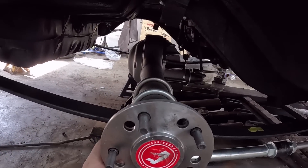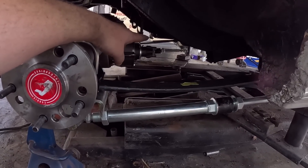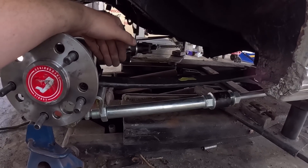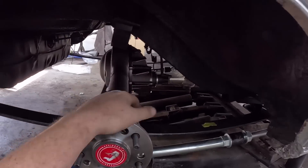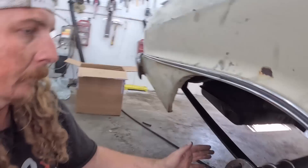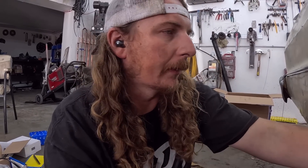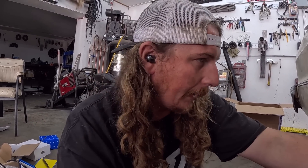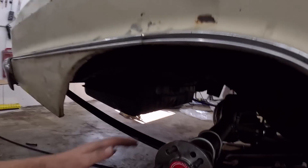I think it's a little bit towards me, so we'll have to loosen the U-bolts and get that centered. Then we'll put the angle finder probably right on the machine bit of the yoke, and that'll give us our up and down degree. We can then tack it in a few spots, then lift it up and get under there and weld it much nicer. I might try and cheat it — just kind of go four degrees, see if we get another half degree out of there or within a degree of the ideal three. I think it'll be fine. I've done this a bunch of times like that and haven't really had any issues. And if it's all wrong, you just cut it apart and re-weld it.